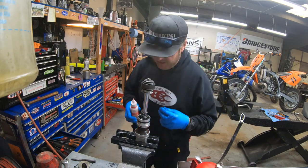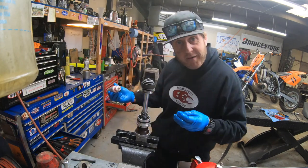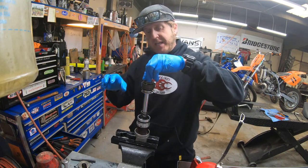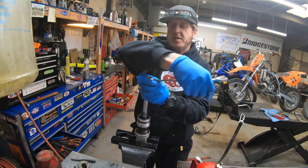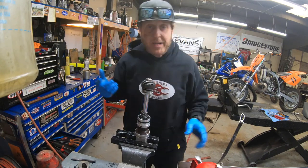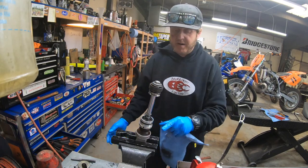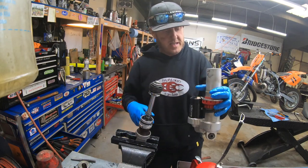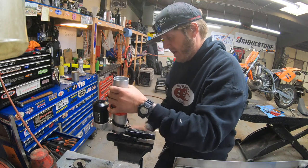Highland cyclist Morgan — that guy has got a YZ450 that's locking up on him, so you guys get to see that too: take a YZ450 apart and maybe even do a bottom end, so we'll see — it's going to be exciting. Because of the Loctite we don't have to go crazy on the tightening, and it does have a lock nut on it which makes that a lot easier and better. Now I'm going to clean the shock body up really good and then we'll reassemble. I'll show you how to bleed it.